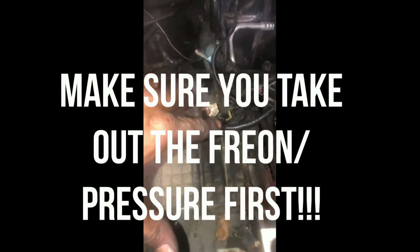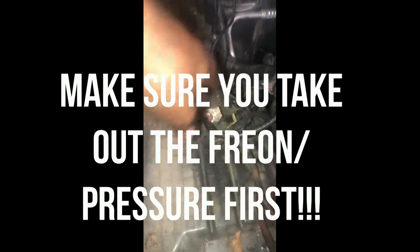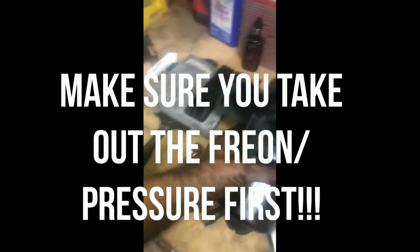You do have to take out the battery box, okay? If you think you ain't gotta take the battery box off, you're wrong. You will have to take the battery box out because the dryer has that lip on it, that part right there. You're not gonna be able to get it past that battery box. So you're gonna have to remove the battery box.